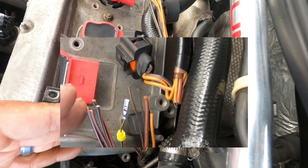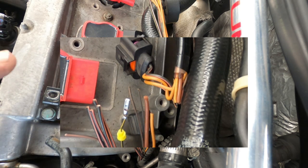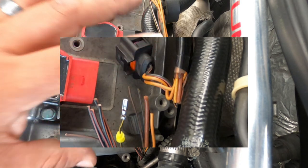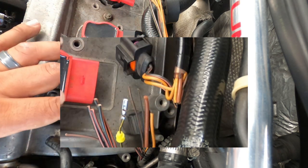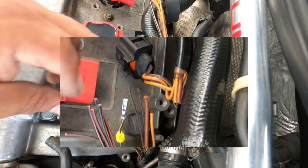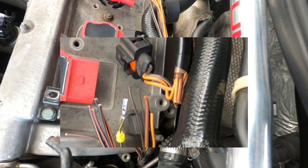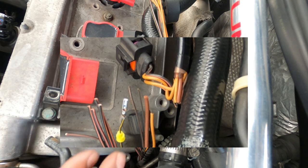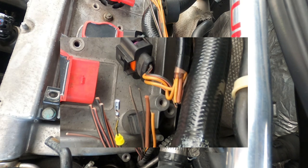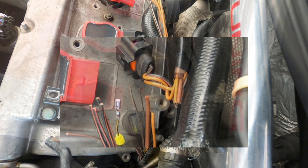Repeat the process. Once you have all of your pigtails done, then we'll actually connect them to the connector. Do not get the connector in the way - do that last. First do all your crimping and soldering, then bring the connector to plug everything in. In the manual from ECS Tuning they have you do that first, but that block gets in the way - this is easier. Just push one aside and work with the next one and repeat your process until you're done.